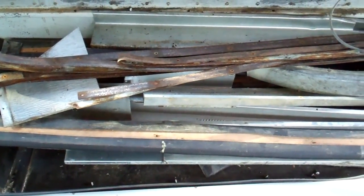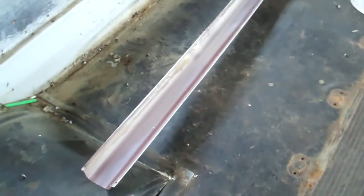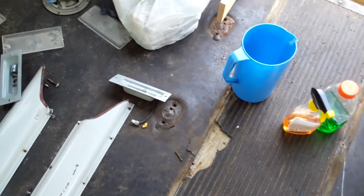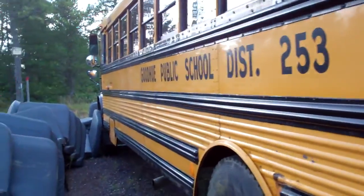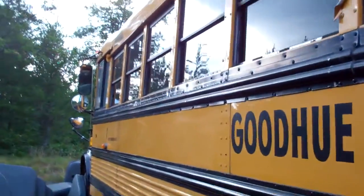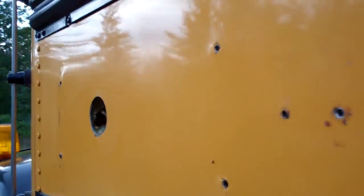But a lot of the sheet metal, I was originally just thinking I'd scrap for free. But I think I'm going to hold on to it in case we want to use it for patches on the floor. We haven't pulled up the plywood, it looks okay. I'm hoping the plywood's going to be okay. But pull the plywood up and look at the sheet metal, see if that's bad. I think it's going to be okay too. But like the hole I took the stop sign out of, that's got to be patched over, so I'll clip some of the sheet metal from the heater vents out and silicone that down, and we can rivet it later if we want to, or just put some sheet metal screws. We got a ton of those now.